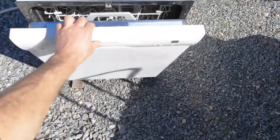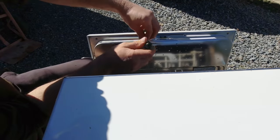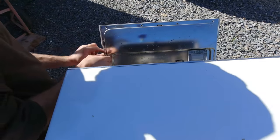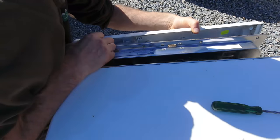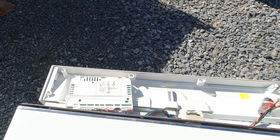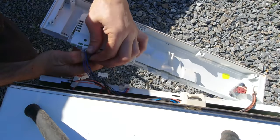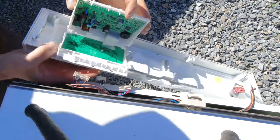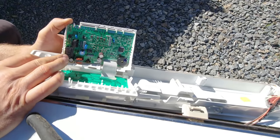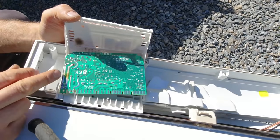It's a fairly simple fix most times — just a matter of taking this front panel off, the top part, and re-soldering a relay. First of all I'll unplug it so I don't get a zap. We just have to take a few screws out the top here. You normally see a little circuit board on the back — so we'll pop that open. Remember, make sure your cord is unplugged. That little black box there is probably our culprit — that's the water heating relay.